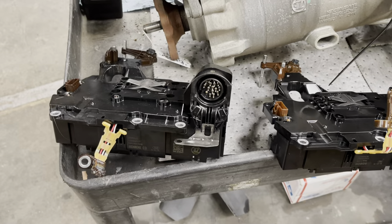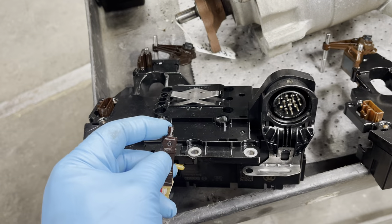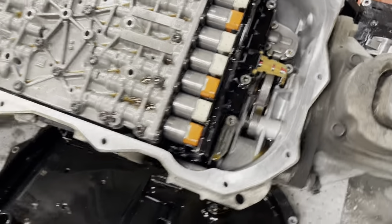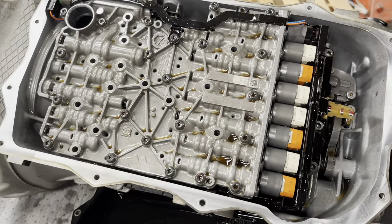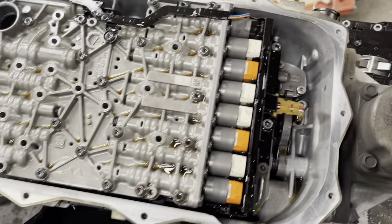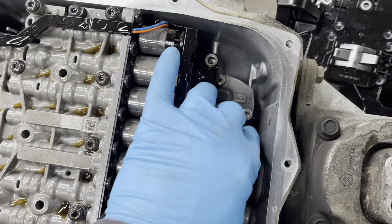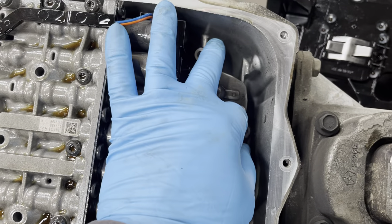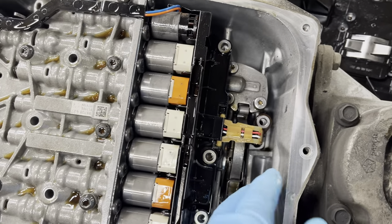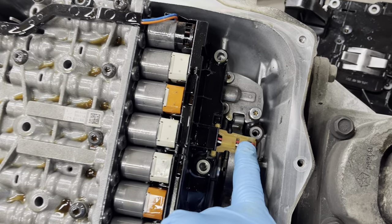We're just going over some highlights. I'm not a training guy, but this stuff's very important. I'm going to make sure this does not get broken. On this transmission, we had to buy the computer for another guy because the computers are so expensive, but this transmission costs like 250 bucks. Now remember, when you're installing this, you've got to seat it down in there, feel it seated, and then you can put the bolt in because it wants to go crooked. You've got to be very careful to make sure you get it lined up, seated in there just like so, and then you can bolt it down.